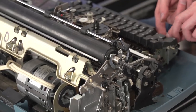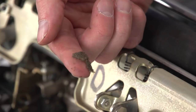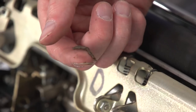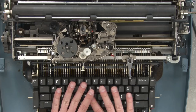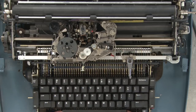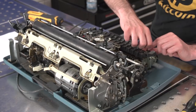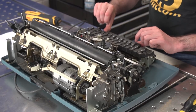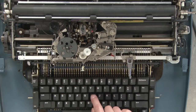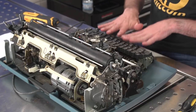So there's this foam down here under the keys. It looks like this. If you've ever dealt with rotten speaker surround rings, it's the same kind of thing. It's all just greasy and crumbly, and it's under the keys here. I'm guessing it's like a dust collecting layer, and it's got everything all gunged up. So like, if I push a key down, it just hangs. Like these, it's all just mush.